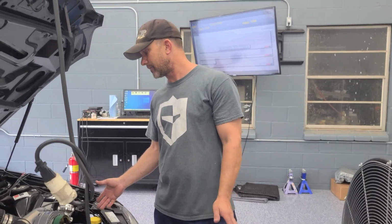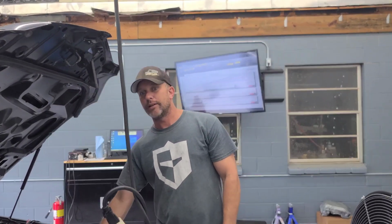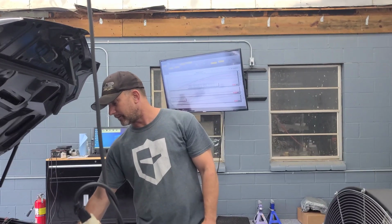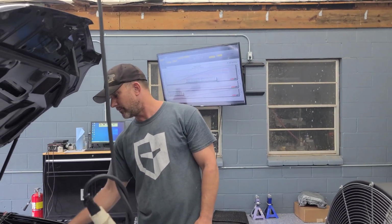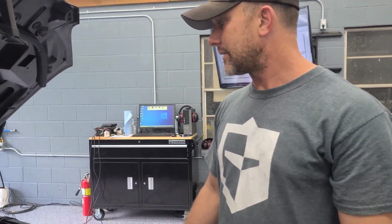I'm pointing this out just because we have all this stuff kind of figured out in a recipe. The F-Series blower also sticks the pulley out about 85 thousandths farther, so we mill the pulleys 100 to compensate for a little bit of bracket flex and move it in. So we got the recipe on these things.